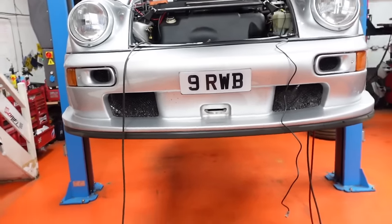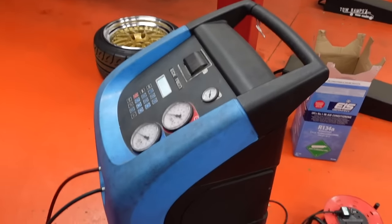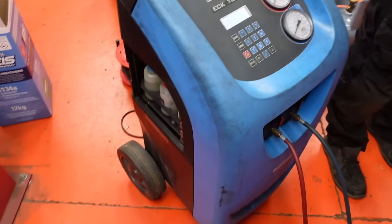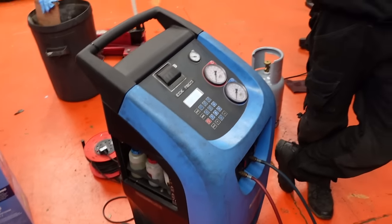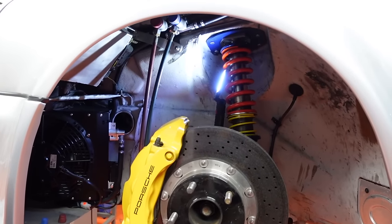We're back after our mapping session - successful-ish, but you'll see more on that next video. Car's back on the ramp. We've just finished up a few little bits and pieces, Jay read some more instructions, and we've configured the aircon ECU now - or best we can anyway. We've got the AC gas, the AC machine and pipes running up to this. First time any of us have ever done this. We're doing a 45-minute vacuum test on the pipes - that's something required before you dump the gas in. Fingers crossed.